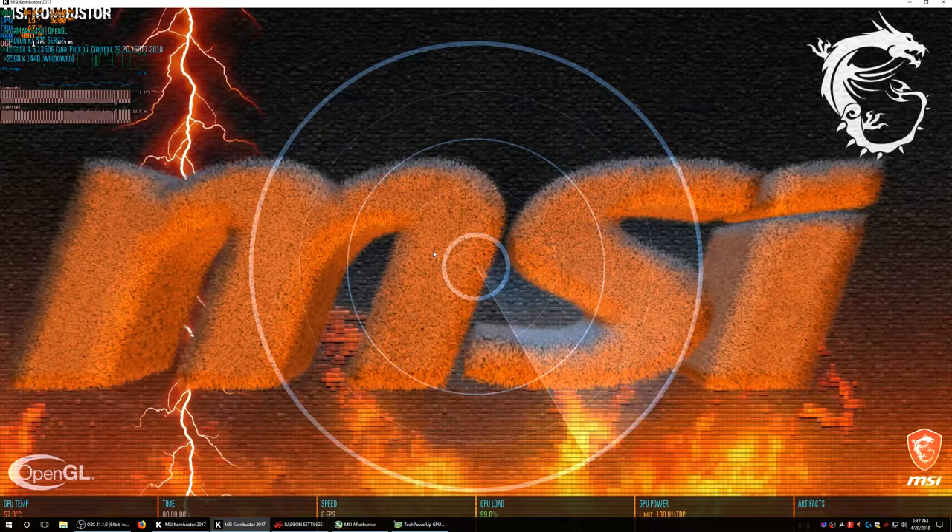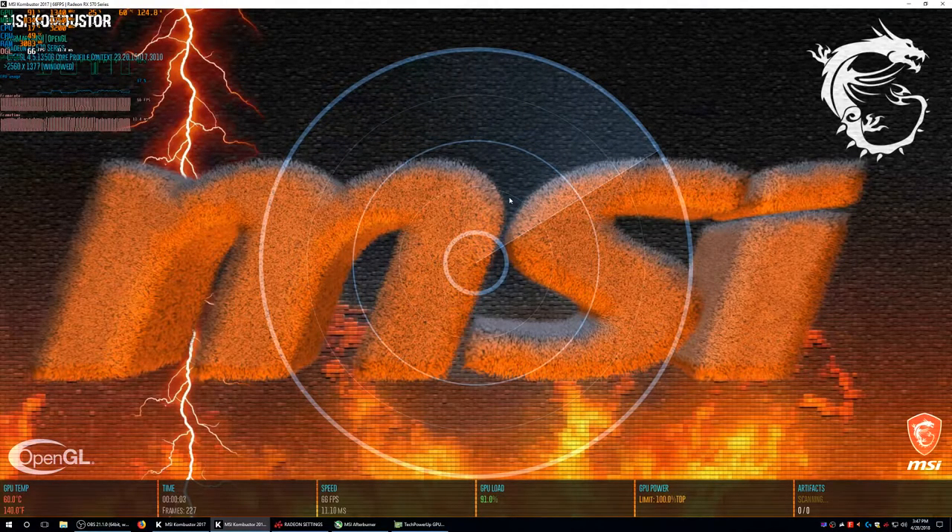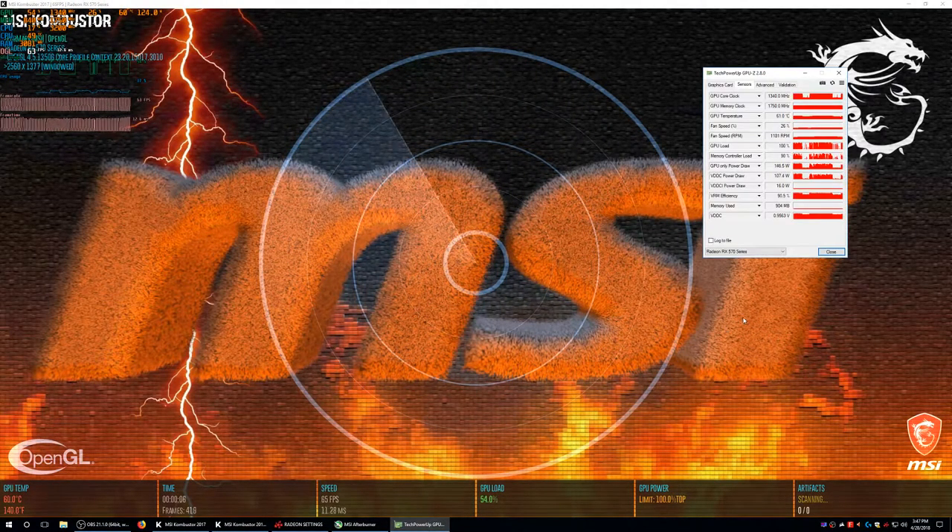Run test. Didn't crash right away. Now we got much lower wattage — there's a bigger difference. We should be going 25 lower than what I put in, which is 1000 mV, and it's going as low as 950-975 mV. Not telling me I'm getting any artifacts. Now I'm starting to see a big wattage decrease. Before I was able to save up to like 30 watts, and maybe another 20-30 watts when playing a video game.